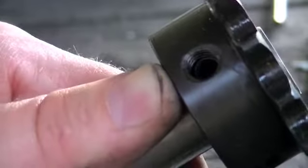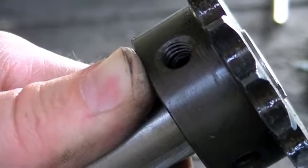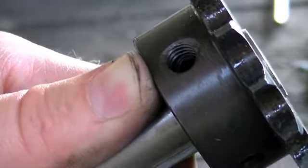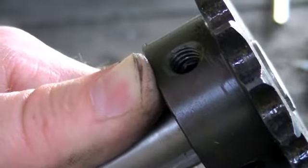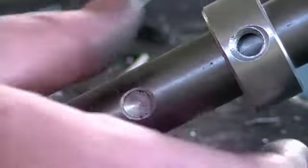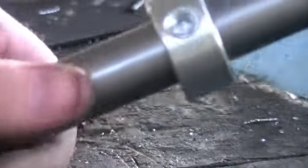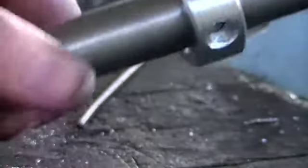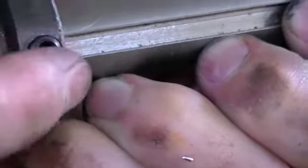You can see how far down it really goes in there, and that's why I'm going to buy longer ones — just so I get that full thread contact and more strength. It's just going to last longer; you're not going to have problems breaking set screws and then chewing up chain or spitting out the jackshaft. That's a real problem — I had that on the mini bike I built years ago. So I'm going to take my own advice and go with longer set screws and some thread locker. The last thing you want to do is also drill one more little landing area for your locking collar on the opposite side of the shaft, opposite from the sprockets. The only set screws you need to replace are the ones that you drilled landings for. All these other little ones — like the one that holds the keyway in place — you don't need to buy longer ones or drill landings. All you need to do is put some thread locker on there and snug them down tight, and that's it.